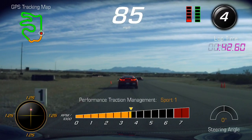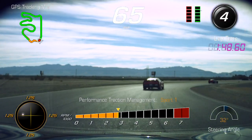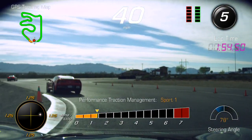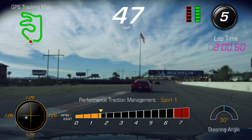Light brakes as we go up into the corner — nice and smooth. Light brakes every time we're changing direction. Now set up for ten. That's all we're doing here — getting ready for a good run out of ten. This is the second most important corner on the track as it leads onto the second longest straight.